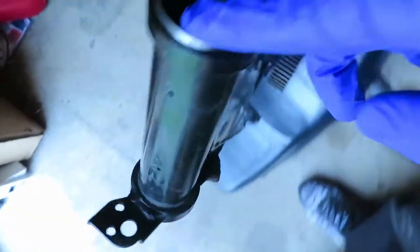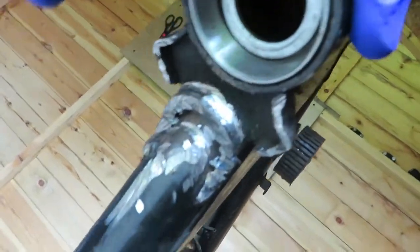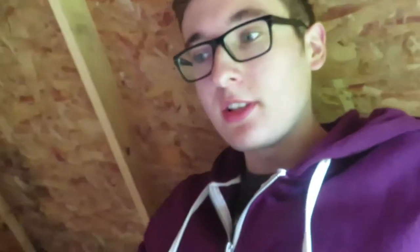I forgot to mention I've already fitted the rings in top and bottom just to sort of test fit them first. I kind of cheated and didn't go for the 'put it in the freezer' method — I actually used quick freeze which shrank it down enough for me to just tap it in. They fit, and they are off the Suzuki — all brand new.